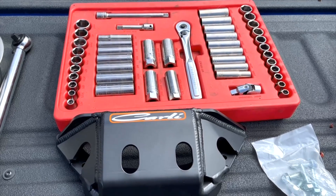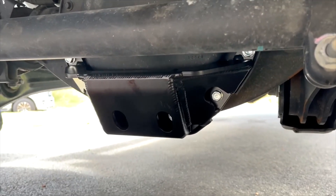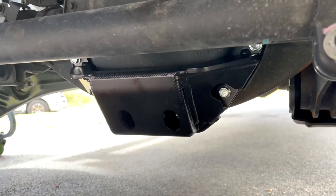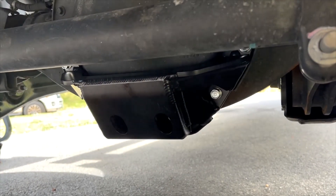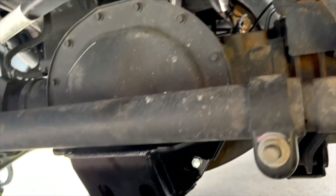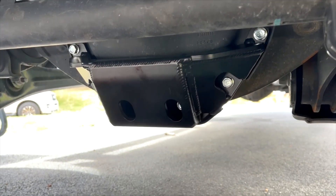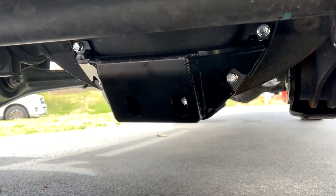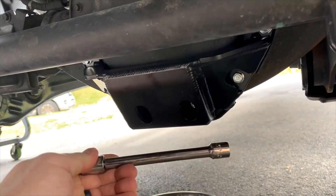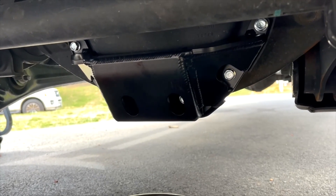Post-install: it went really smoothly, looks really good. I ended up using red Loctite because it was on the bolts — they give you an extra one. You'll need a 13-millimeter socket for the big bolts and a 10-millimeter for the original sizes. It's a 12-bolt front and you remove six. Zero drips — I didn't yank on the cover at all. No grinding required; it fit right on. Torque wrench at 25 pounds, and you'll need an extension to get through the bottom two bolts. Could not be a smoother install — five minutes.